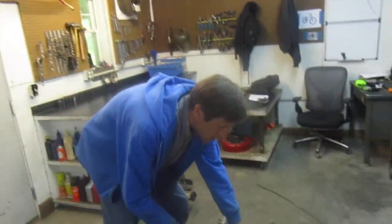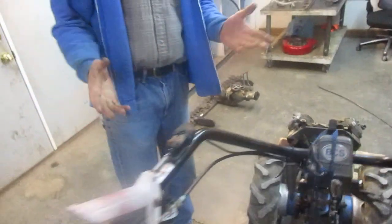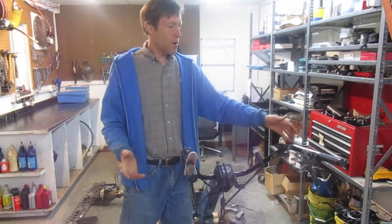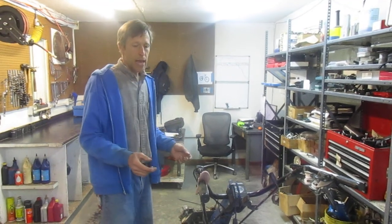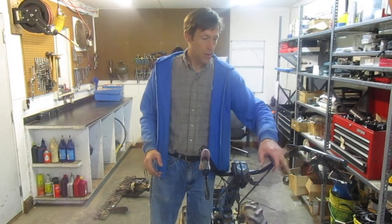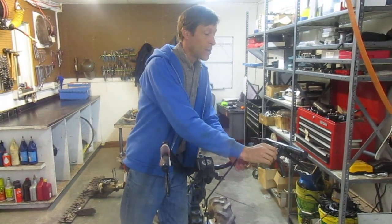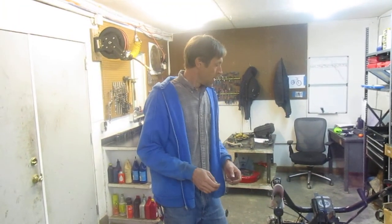Now that I know my cable tension is pretty close to right, I'm going to give the clamp an extra little twist to make sure it stays on there good. The same basic procedure can be used for all the cables on the machine — whether it be the brakes, the forward/reverse, the differential lock, or anything like that. The system is the same. On many of the other levers you don't have to deal with the spring — that's pretty much specific to the clutch. All those other handles just flop all the way down and you can pull the pins if needed. Thanks for watching.